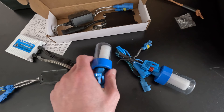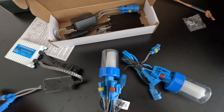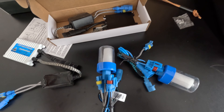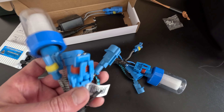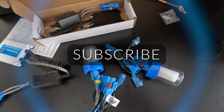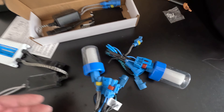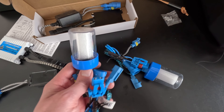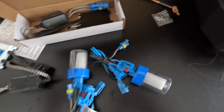These are 5,000K. The maximum output you'll probably get is around 5,000 or 6,000K. I used to get 8,000K in all my cars because I kind of like the blue tint, but it really does diminish the throw of the light. HIDs also turn bluer when they start to die and get dimmer. Some companies will say 5,000K is white or yellow — it may depend on the brand. Aim for ones that say bright light, daylight, or white light. The 3,500K and below will be yellowish, which is really ugly in my opinion.